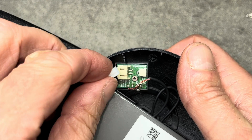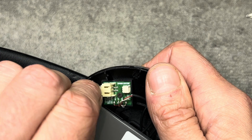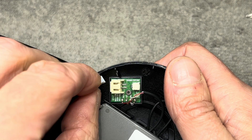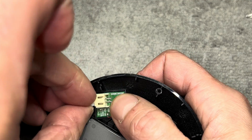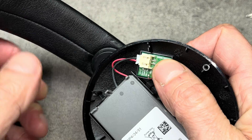Make sure you have the connector in the right orientation. You see this little line on the top of one of the connectors — that's the one that should be visible when you plug in the connector. It's a little bit finicky and you need small hands to get that connector in there, but eventually you'll manage to get it plugged in.